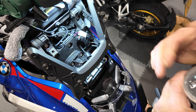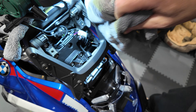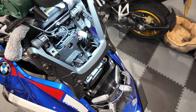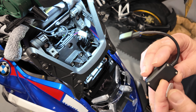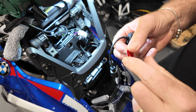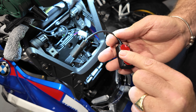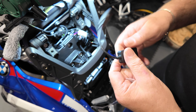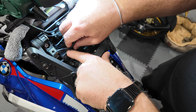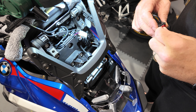Spray a bit of alcohol rub on the surface, let it clean the plastic up so it bonds nicely, then let that dry off. Take the supplied 3M pad and remove its backing, then pop it on the back of the CGRC LIN adapter. If that screw ever has to come out for servicing it would need to be removed, but I can't see that happening regularly, so yeah, I think that'll do nicely.